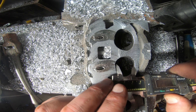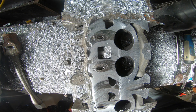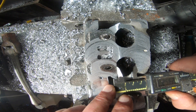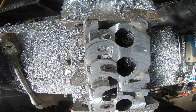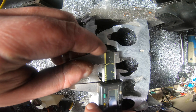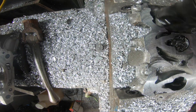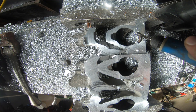Weird shape ports here — 26 by 28. It landed right where the valve guide starts: 25.6 and 26.7. Interestingly, the port's getting bigger where the valve guide is. Obviously Toyota spent a lot of time optimizing this thing. 25, 25. We'll get one more cut and we'll get into the valve seat when we do that, but won't be able to go edge to edge — the VFD said nope, too much load. So that gives us the whole view of the port anyways.